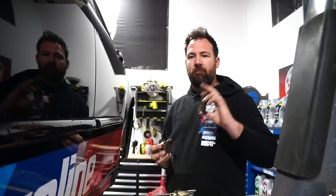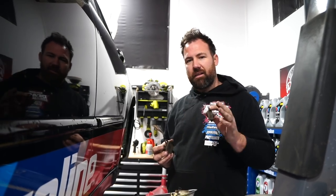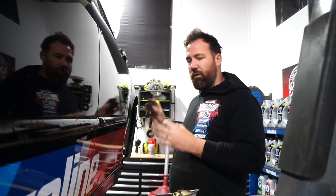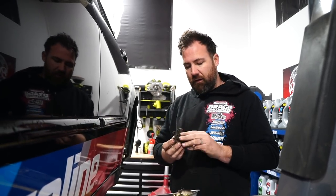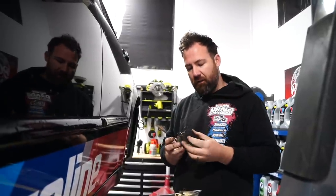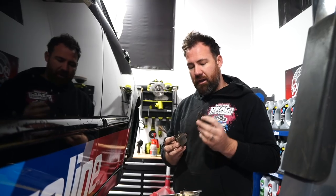Now, being that this is a Motorkhana, you don't get laps, warm up, anything like that. Literally, you can warm the engine up, obviously, but there's no brake warming up or anything like that. So yeah, it's actually really good to put just some basic street pads in the back of the car, especially if you have a hydraulic handbrake.